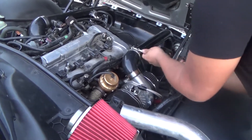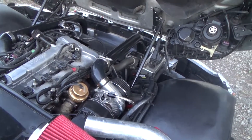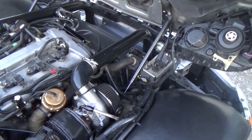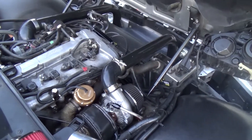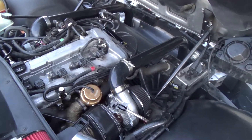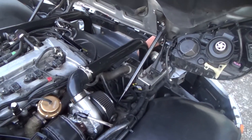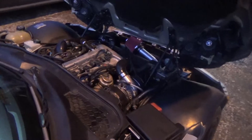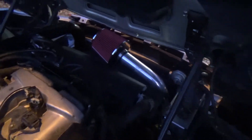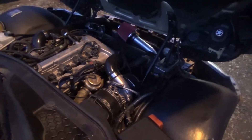After struggling and going back and forth — do it, not do it — we're actually going to do it and take the cold side charge pipe off and put this filter on with this pipe so the turbo's not really doing anything. If I was just driving normal suburban-type roads I think I'd have been fine, but on the highway I'm not sure — I don't want any extra boost in there screwing anything up that the computer doesn't like. So we'll take that off and head home. Getting ready to leave, we got the new fake cold air intake there hooked up with the cold charge pipe out of there, so I can at least make it home on the highway without worrying to death about it.